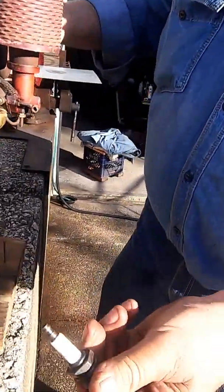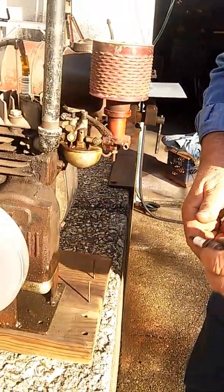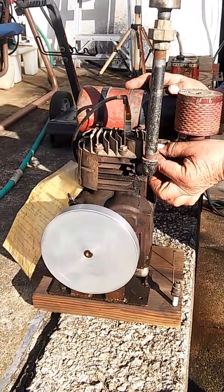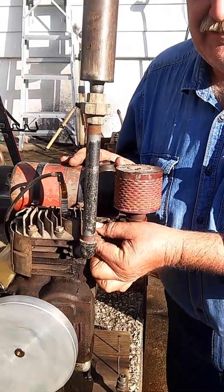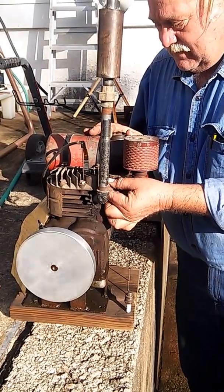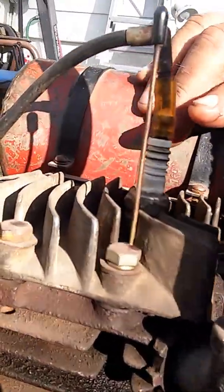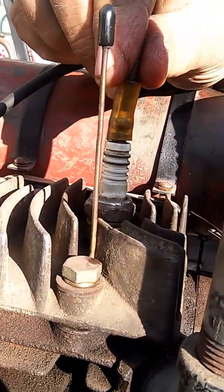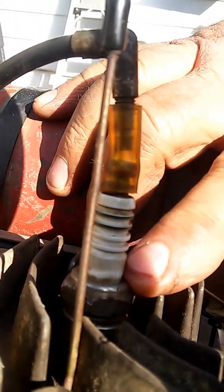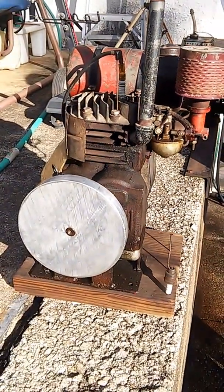It's got a spare spark plug — old AC 45. That's back before everybody was all precious about it: 'Oh my God, you've got to have the right heat range or you're going to burn the top out of the piston.' Truly, if something like this is just sitting and running, it's not that critical — it's kind of like a cotter pin on a farm wagon. At nighttime you can watch the spark jumping between the spark plug and that little piece of wire. See, that bolt has got a gap between it and the top of the plug, and with that being on there it makes the spark jump — same thing a resistor plug does inside the plug. It's all just learning, experimenting around a little bit.